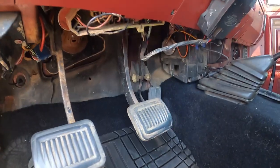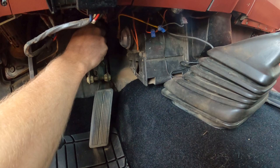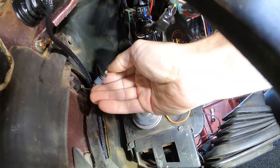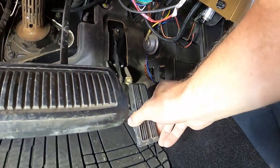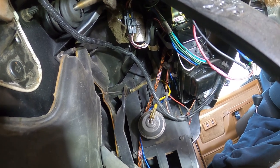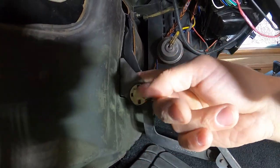You guys know I just put new carpet in here, new padding. So here's our throttle pedal — look at all that play. When it's all the way to the floor is when it actually pulls on the throttle cable. So we've got a ton of play in the pedal before we even pull on the throttle cable, and then we've got a ton of play in the actual cable. If we pull the pedal back, you can see how much extra room we have in the cable. Let me show you in the OG crew cab what it should look like — no play in the throttle cable. You push the pedal and it pulls the cable immediately. And that's what we want. In inspecting this, I noticed that the pedal on this one is sitting out about an inch off of the firewall.